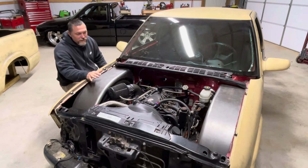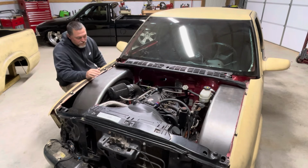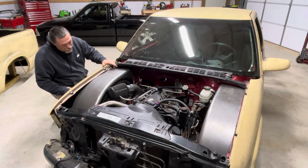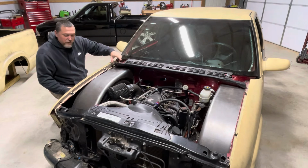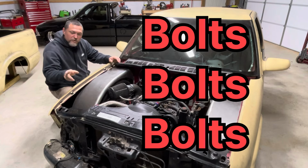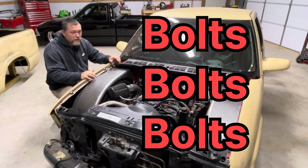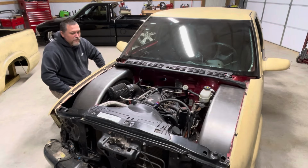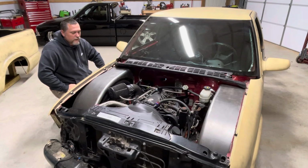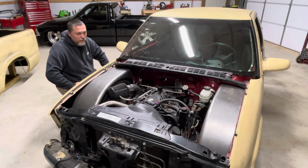Anyway, this is kind of where I'm at. Tandem axle trailer fenders cut down, test fitted. Gotta still do some trimming here and there, and I'm gonna mount some tabs underneath this end on the firewall on both sides. Put some screws through to them, same way on the front. Use some angle screws to hold them up, a screw right here in this area on both sides. May flatten the inside of these fenders out, smooth them up. But I'll definitely get more detail on the next video while I'm doing all this.